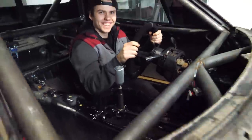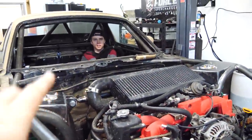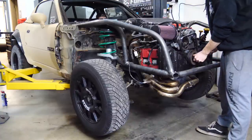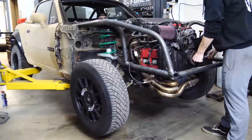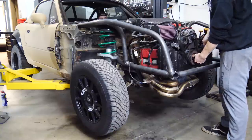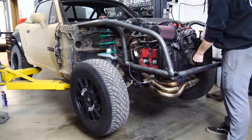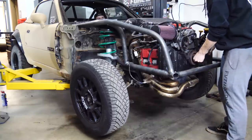You're going to put it in fifth gear. There you go. Fifth gear. I'm going to turn it over. It'll spin the wheels, and then you'll push the clutch in, and then it'll stop spinning the wheels. So the clutch is engaged, so doing this will spin all four wheels. Okay, Pasha, push the clutch in. Yeah. Hey, and they don't spin. All right, drop the clutch now. Oh, all-wheel drive launch. Cool, all right. So the clutch is working, it's engaging, it's disengaging, the brakes are working.